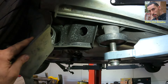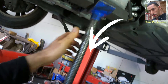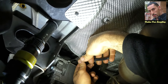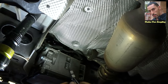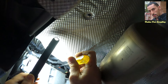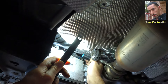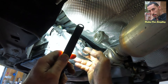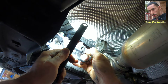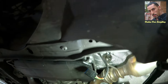Very important advice: don't let the stand lifter lift up the car when you are lifting up the engine, because if it lifts up the car, the car will move from the hoist and can fall down — this is very dangerous. To take off the computer plug for the transmission, you need to open this red key, push it in, click it in, and pull out — click and pull out — and the plug will come out.